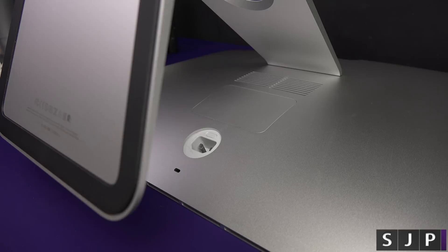Here's the nitty-gritty. First of all, please unplug your computer. Turn your iMac over and stick it down face-front onto a table. Make sure there's no dust or anything on the screen — you don't want to scratch your screen. I know it's not a touchscreen, but you still don't want to get it scratched.